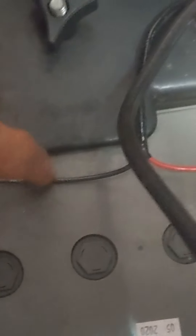We sent a hole through there and then sent the DC leads to each battery. We installed eyelets — they come with alligator clips, but you can request eyelets, which I would recommend. You can see we have a negative DC lead to this terminal and a positive DC lead to this terminal.